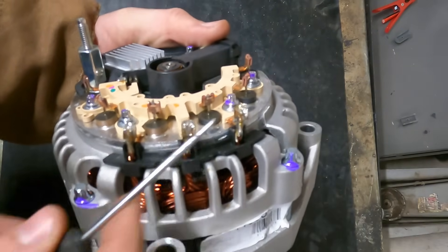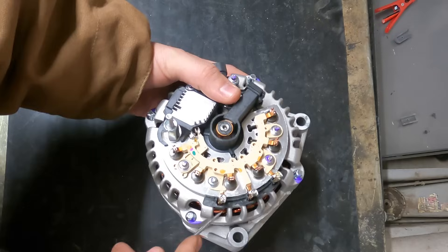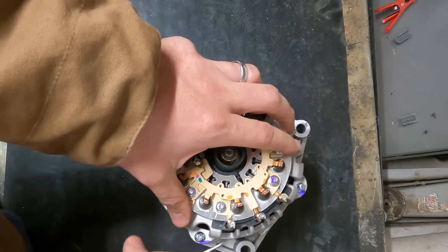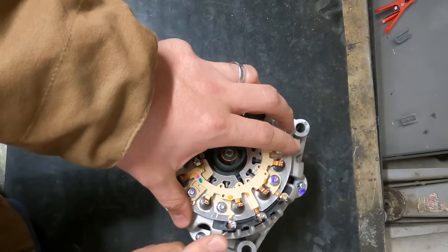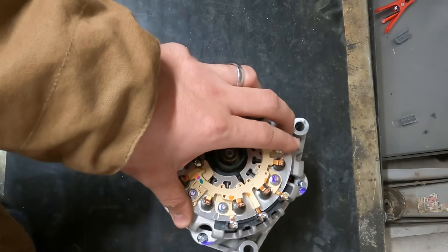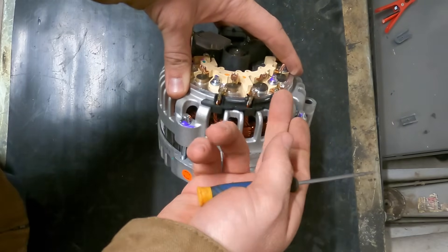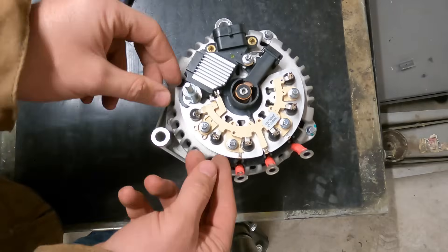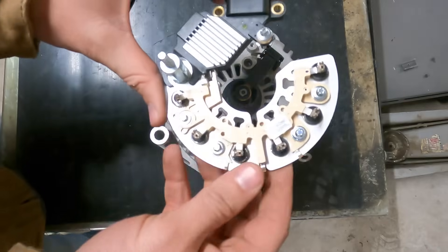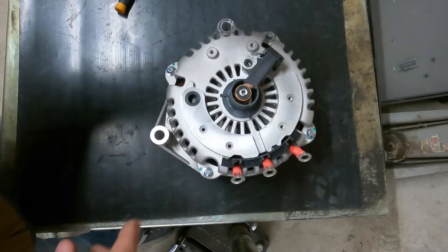What's going to happen when we do that is it's going to turn the electromagnets inside the alternator full blast to give us as much power as it's capable of producing. One more thing you need to do to remove the bridge rectifier and the voltage regulator is desolder the leads on the stator from the clips on the bridge rectifier. I couldn't get it to heat up hot enough - I had a butane torch and held it there for like a minute and still couldn't indent the solder. So what I ended up doing is just cutting, and that worked just fine. Once you've backed all those bolts out it should lift straight up as one unit, and you can see where I clipped the stator leads going into the bridge rectifier.